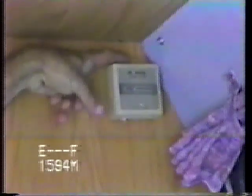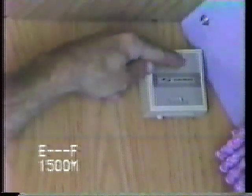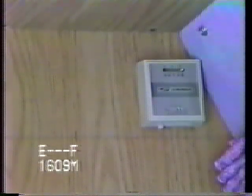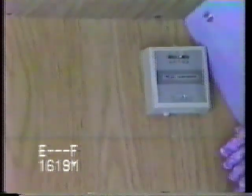When you're cold, you'll want to turn on the forced air heater — just like at home, it works the same way. The thermostat control is up here: the top sets the temperature you want, and when you're igniting it push it all the way toward the wall or up to 90 degrees. The little dial tells you how hot it is inside right now. Push the on-off switch toward the wall — it'll click, and in a second or so you'll hear the fan come on and it'll start putting out warm air. Set the thermostat for 75 or 80 degrees and it'll cycle on and off to keep the temperature nice. The vans have an R17 rating for insulation so it holds temperature fairly well. When you turn it off, push the knob all the way down to cold and flip this off. The fan will continue to run for two minutes to get the emissions and heat out of it, then it will automatically shut down.